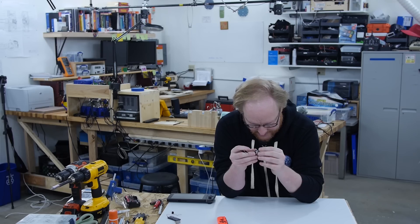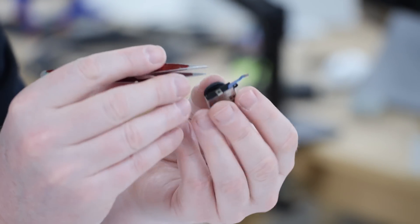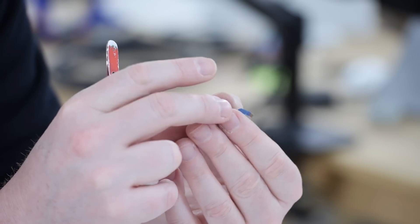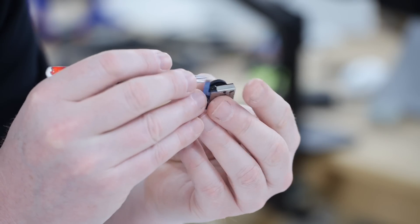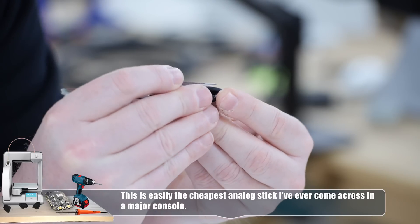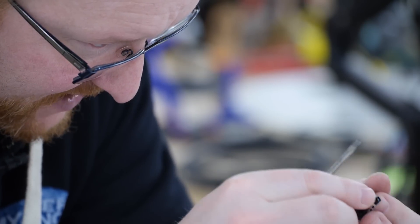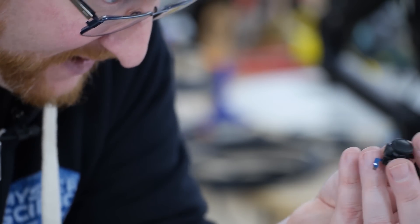Ta-da! They bent the can around this. The older PlayStation Portable had a fairly straightforward analog stick — four leads, two were positive and negative, and the other two were the analog wipers. Then the PlayStation Vita had something like a Hall effect sensor, where the analog stick would move magnets around and detect the position and proximity of the magnets to determine the tilt.